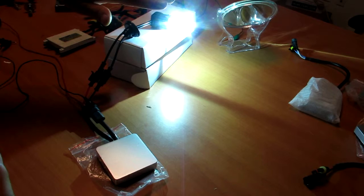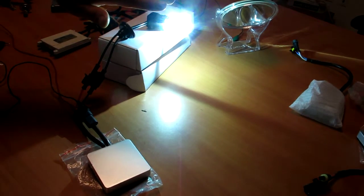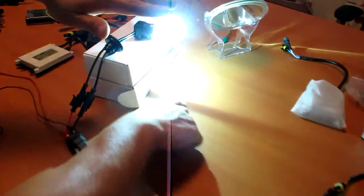At first we didn't know entirely what they might be talking about until we pulled a few sets to confirm this ourselves. In this video I'm pretty sure you can see this is the raw shadow, but intermittently you'll see it shake, as if it wants to regulate its voltage differently, but we're not too sure what it is. This shaking gets even more pronounced when the light is outputted from the headlight's projector. It's a big annoyance to our buyer to see this on the cutoff line down the road.